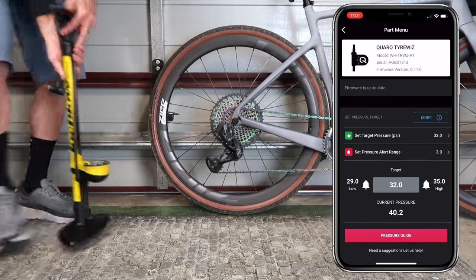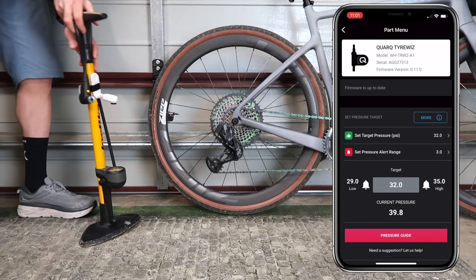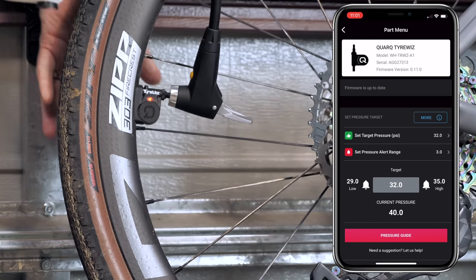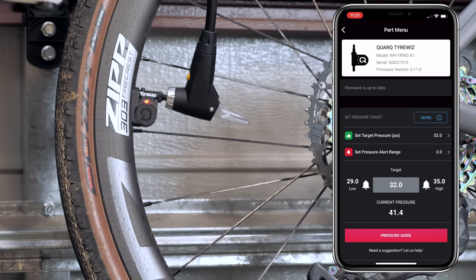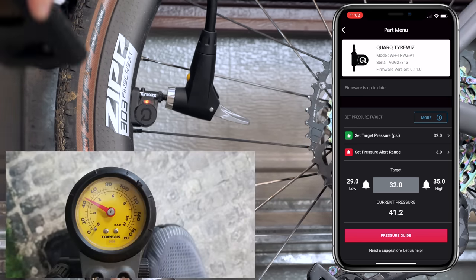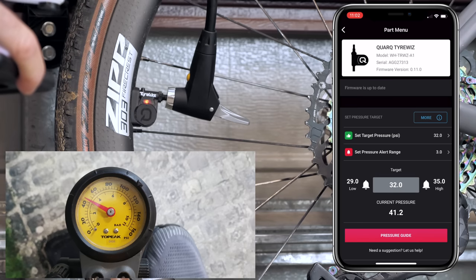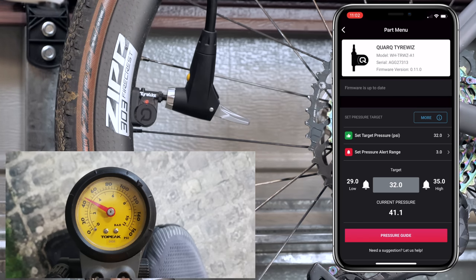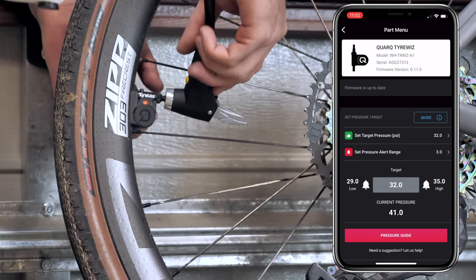Just to be sure, I'll leave that at around 40 psi and bring in the original pump to put some pressure in the hose. Okay — 41.4 on the Tire Whiz, but the gauge is reading well over 40, and well over 3 bar if that's what you measure in. So that pretty much confirms the gauge on the old pump is no longer up to scratch. I have fully serviced the old pump — taken it all apart and rechecked all the seals — but it's just not up to scratch.